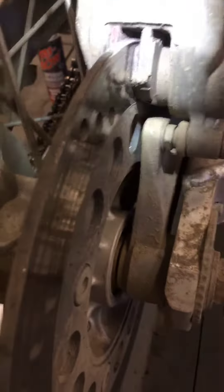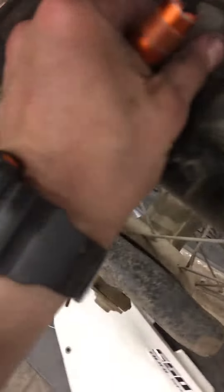Come back here to the rear. Notice rear brake pads are getting pretty thin, so that's definitely something you want taken care of here quite soon. Also brake fluid is quite dirty as you can see in here. So something we can do is rear brake pads and brake fluid flushes front and rear. Rear tire is fair on tread — I know you're doing a front, so I'm looking to do a rear here soon.